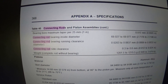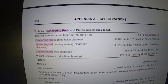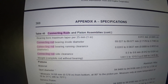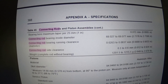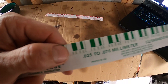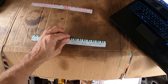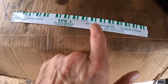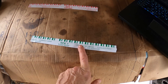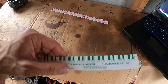According to the Navistar service manual by International, the connecting rod running clearance is 0.0203 to 0.0837. My plastigauge here is 0.025 to 0.076, so the parameter is slightly outside my plastigauge range — just like when I plastigauged the others. So if it's anywhere in the center of this, it's completely fine.